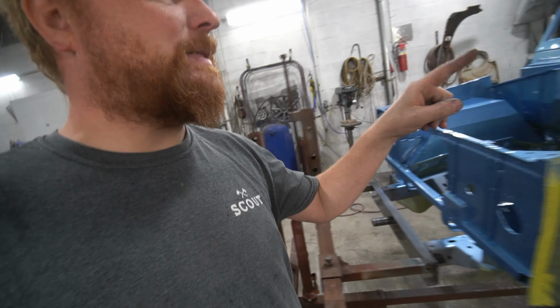Found 2,000 is pretty good for the compound I use. 2,500 works real good. And that's a little one-two on what we're doing as far as the wet sanding process on this. Now we're going to hit the rest of this with 1,500 and go back over it with 2,000 and get the buffer out.